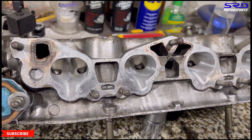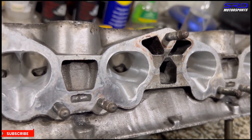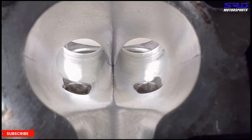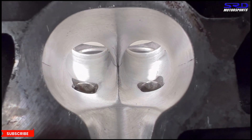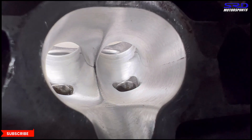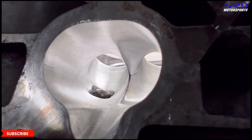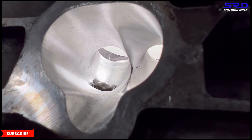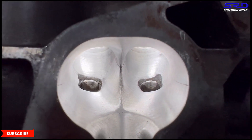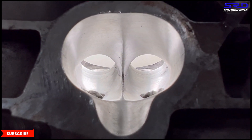Would you look at that — you can see the transformation from its stock form. That's an 80 grit finish, but 120 on the bowl areas. Looking at the intake ports closer, you can still see the core shift is still there — we didn't totally remove that. When you remove it, you start skewing the port the wrong way or bending it sideways, and the cross section won't be right. This is how it is and how we do it. The texture is really good. Even the light shows the shape of the port floor. The port roof is good too. This is going to flow really, really well and create good torque. This is how I like to port — not just the D16A6 or D15B7 head, but every head in general that we work on.